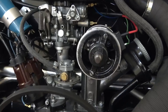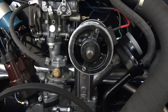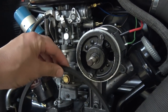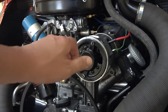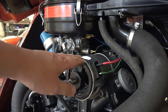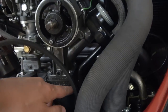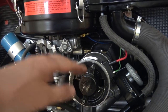What was happening was, since you powder coat these pulleys, it's such a slippery surface that the belt was slipping in between the two pulleys that sandwich it together. At high RPMs the belt was slipping, so the generator was not performing efficiently enough and was not cooling the motor well enough. I would go out for a short drive and the fan shroud was so hot, the dipstick was so hot to touch — the motor in general was running very, very hot.